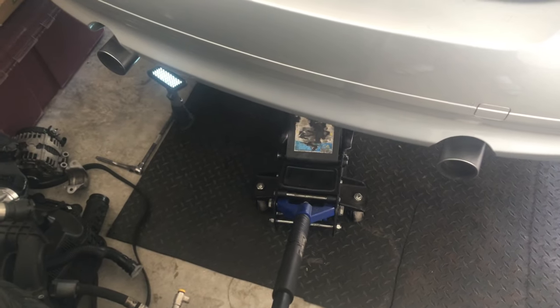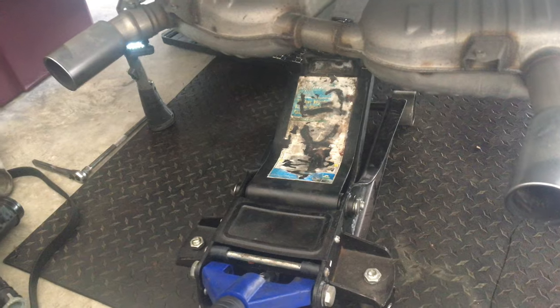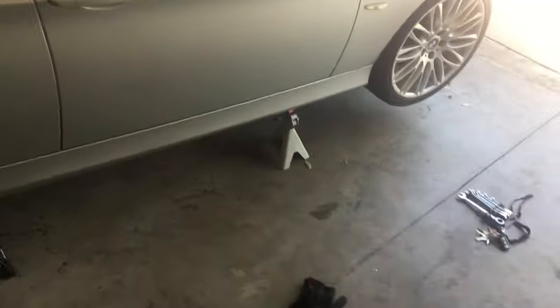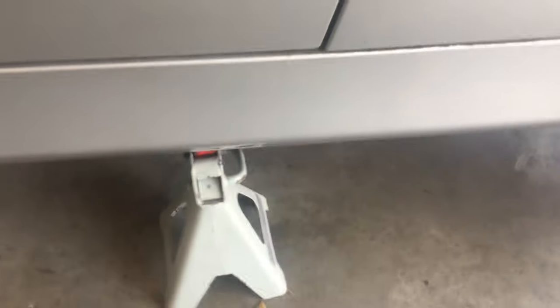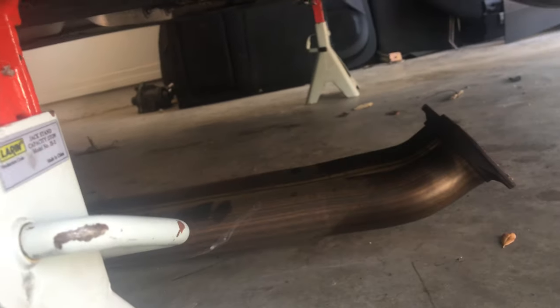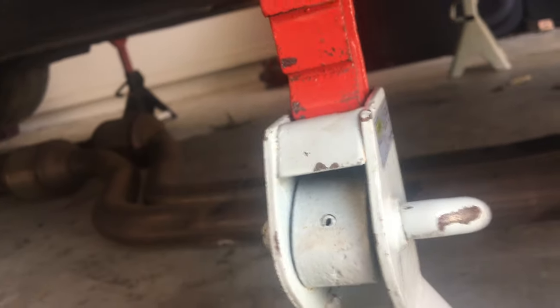I'm going to go ahead and drop the exhaust down now — lowering the jack. Exhaust is lowered down. The only part that's left now is to bring the exhaust backwards and it will come off, but then the tip's going to fall off on the other end and drop on the ground. Easiest way is to go up to the front and back it up a little bit off of the downpipes, because that's the only thing that's really holding it in place now. Just wiggle it — pull it back a little bit and then bring it down to the floor. Now the exhaust is out — go ahead and move it out from underneath the car.